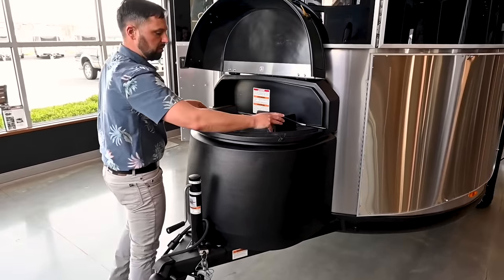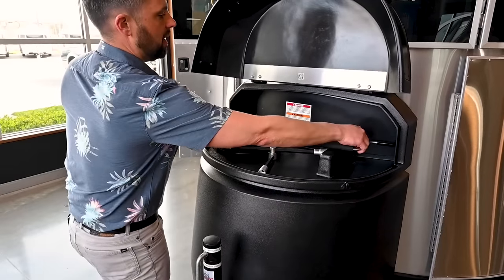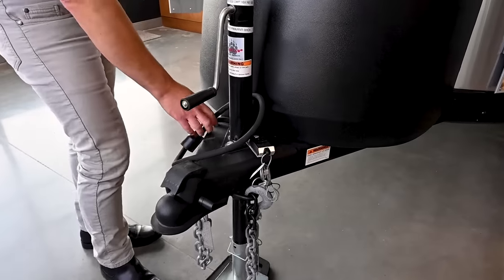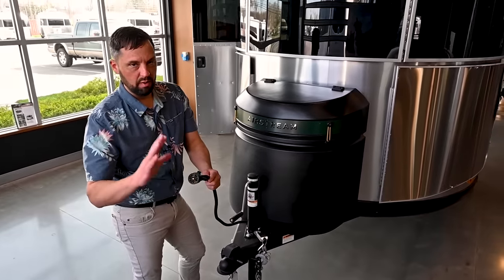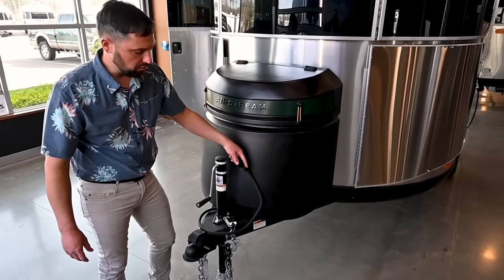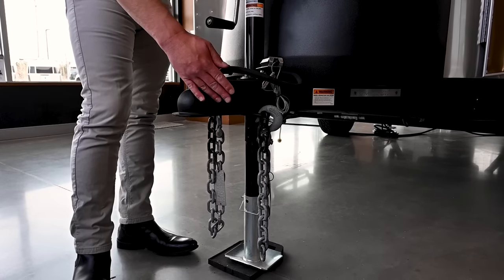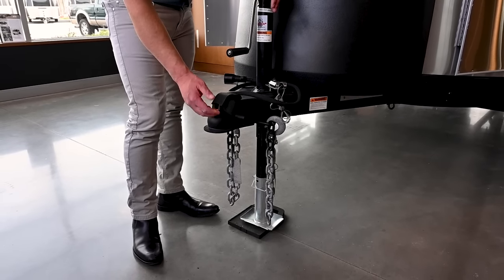The cover goes back on and slips into a groove. It also has the stabilizer jack crank with a three-quarter inch socket. This is a manual hitch jack up front. This trailer does have electric brakes, so you are required to have a seven-way wiring harness on the back of your vehicle with a dedicated charge lead — very important. Your vehicle will also need an electronic brake controller, whether wireless, hardwired, or integrated factory. The hitch ball size is 2 and 5/16 inches and it has a Demco coupler lock. There's also a hitch lock built in at Colonial Airstream, which prevents someone from stealing your trailer.